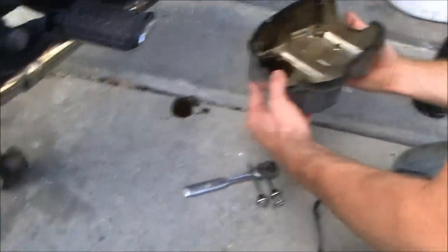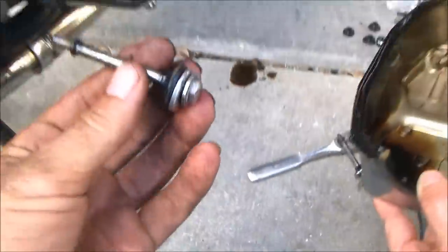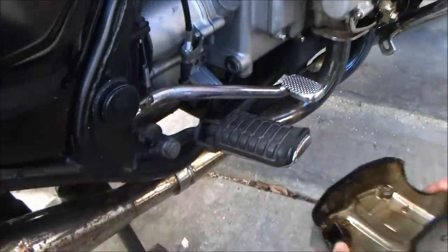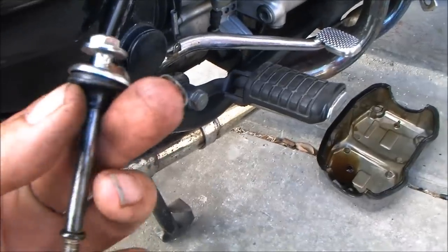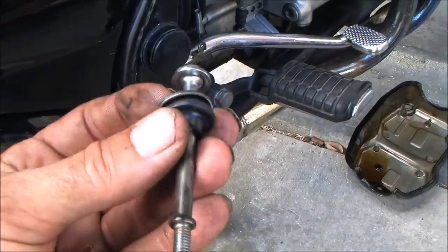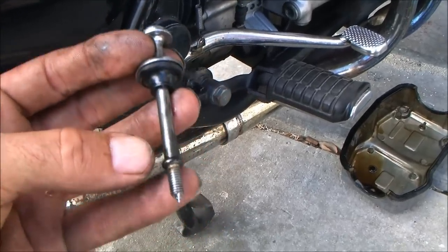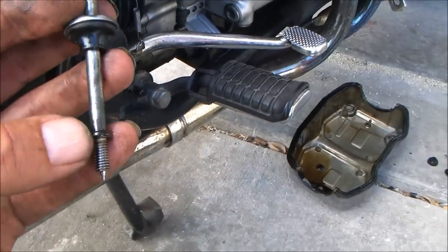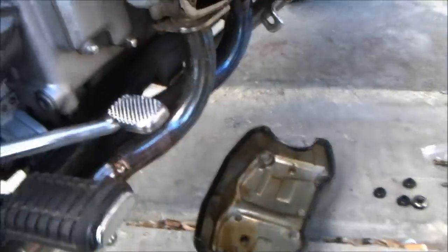Tristan's changing out these little rubber things on your Gold Wings — and a lot of Hondas in fact, like that little CB and CX 450 in there, and that little 450 Nighthawk, they've both got these on them. These little rubber things are what really hold down your valve covers onto your gaskets, because there's a stop in the nut, and the pressure from these rubber things holds your valve cover to the head.